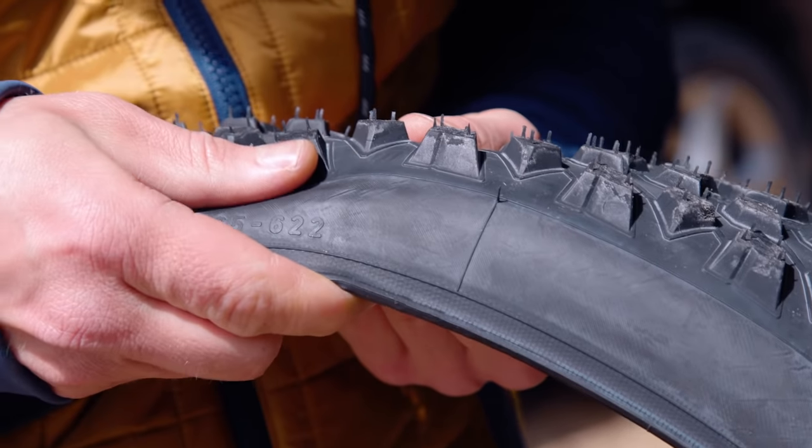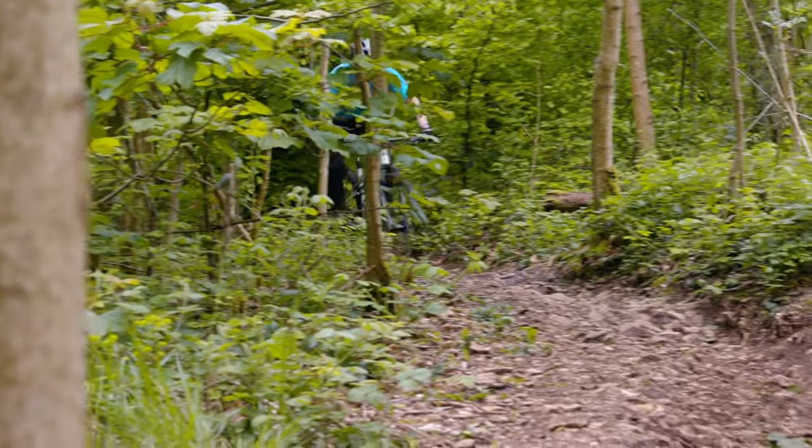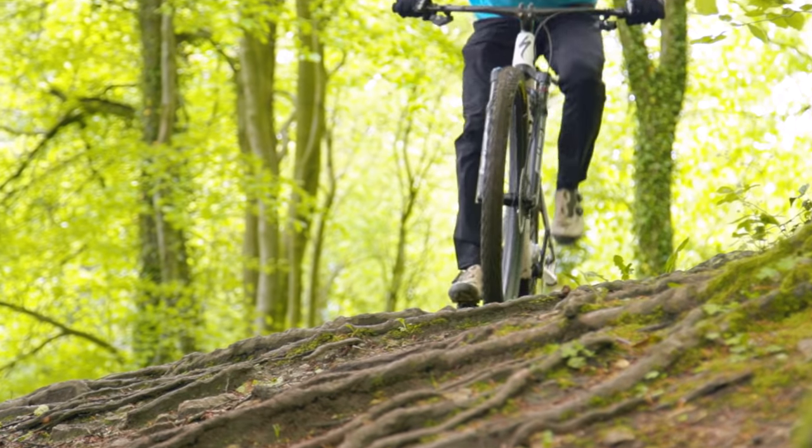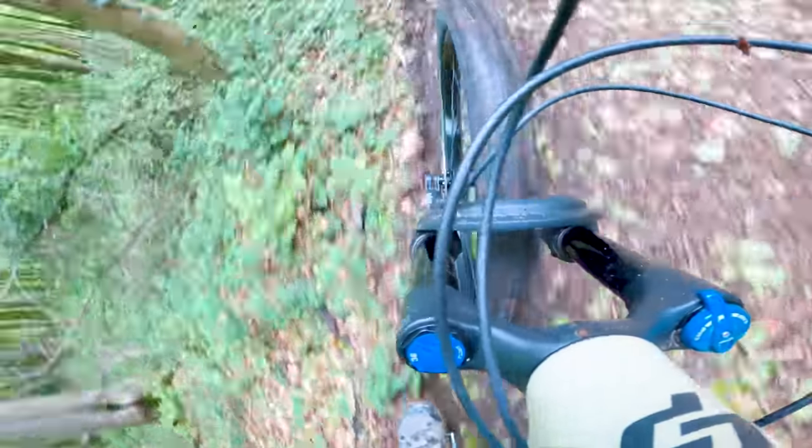I'm going to start with a little disclaimer here. What works for me might not work for you. Everyone has different experiences and preferences when it comes to tyre pressures, so treat this as a guide, not a concrete system. When trying to decide on a tyre pressure, we're always looking to balance a number of things: tyre stability in corners, insulation from trail features for grip, resistance to punctures, and rolling resistance. How do we find a trade-off between grip and rolling speed? I'm going to talk about the various factors first, then go on to some numbers.